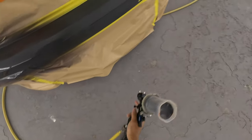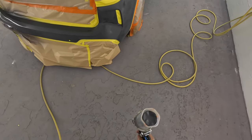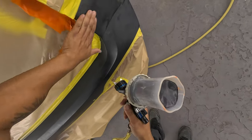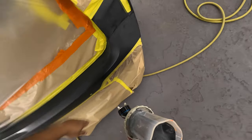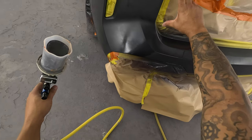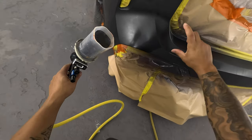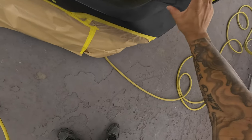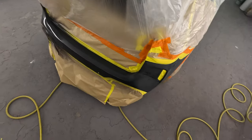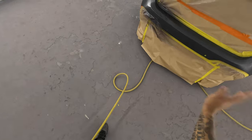Getting most of my coverage in my first coat. There are two areas on this bumper you don't want to put any paint on. See this part right here — you don't want any paint right there. Same thing on this side, that same spot right below the tail light. When you're doing these bumpers, you don't want any paint up there because when that tailgate comes down, it's going to match right to the side of that bumper. Keep your paint away from those two areas — no base, no nothing below that.